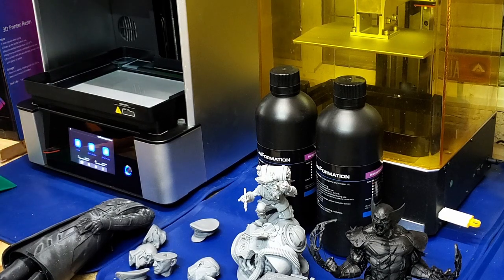And what I believe this micro switch is for is up here in the top. When you open that up, I bet it disables those heaters. That way it doesn't sit there and run constantly trying to heat the outdoors, inside your house. So I think that's what that micro switch is for. Pretty sure that's what it's for. But yeah, it's done a wonderful job.